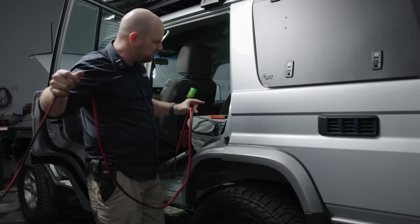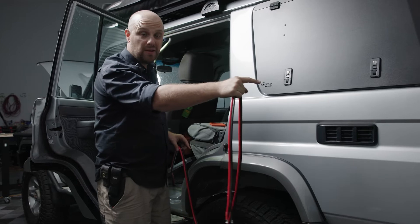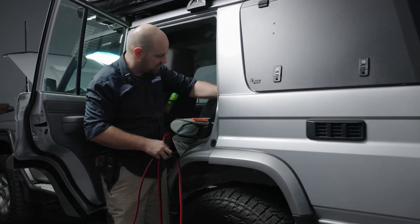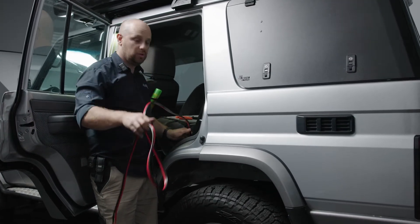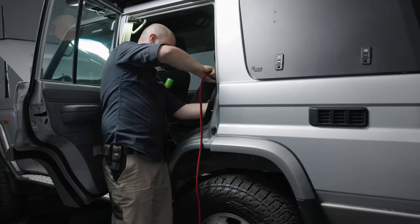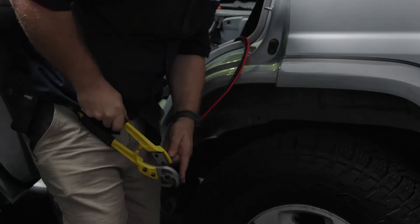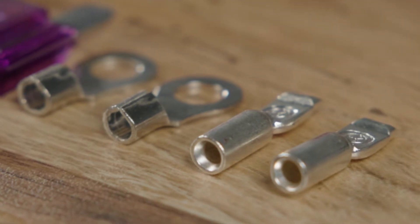We're up inside the vehicle. You could leave this cabling as long as it is, especially if your DC charger is right in the back of your car. But mine's sitting just behind this C pillar, so for a little better electrical performance I'm going to shorten it — just cut it to length. I'll rough in how long I need, give it a chop, and re-terminate the ends. That's why those included extra terminals are so handy — they've thought of everything.